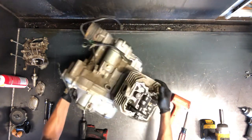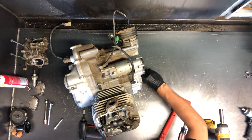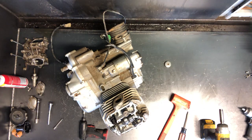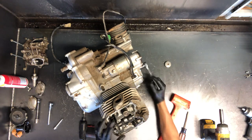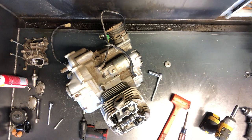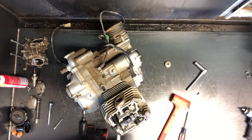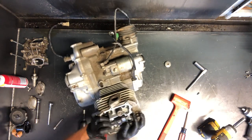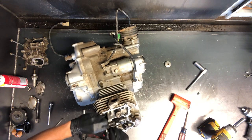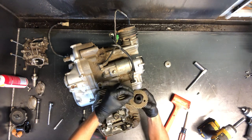What I do is pull this 10-millimeter Allen cap off here. You can see where that fuel's been in here — it's really dried this out. We've got our cap off now. We can take a 17-millimeter and you'll be able to see we're turning our cam. Now what I'm going to do is remove this 10-millimeter on this sprocket, then turn the crankshaft over with this socket directly on that shaft and take this one off. Now that cam sprocket is free — we're able to lift that cam out of there without the cam chain holding us up. We're just going to set that cam chain down beside it to get this all out of here. There is your cam right there with your sprocket.